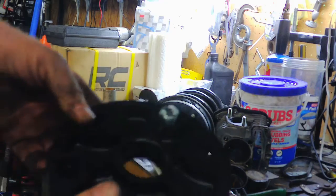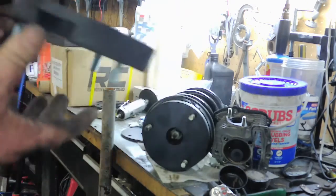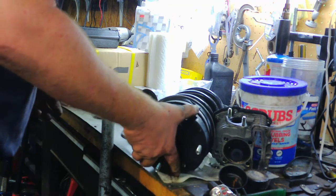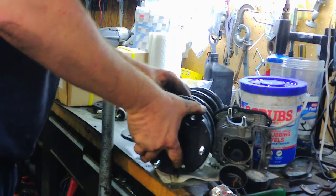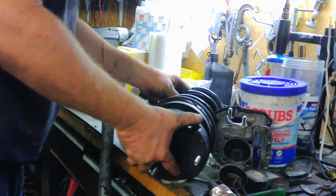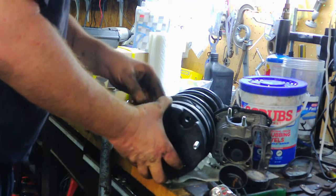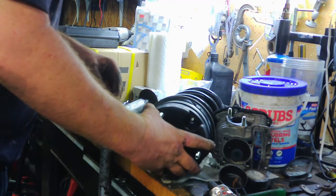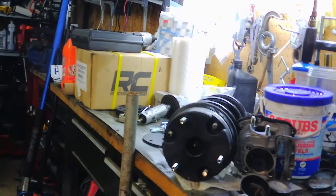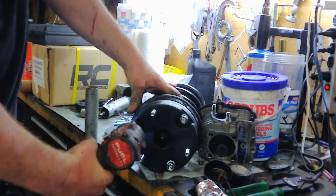And you're going to put your 3 bolts down into the cradle, the hex holes. And then you're going to just put this upside down and put it over the top of this spacer. Like that. And then we're going to install the nuts that are with the kit. Alright, once you got the washers installed, the nylon nuts, you can go ahead and torque it down.